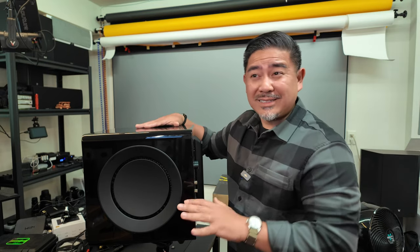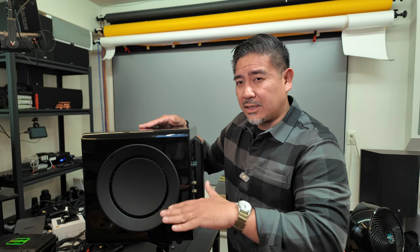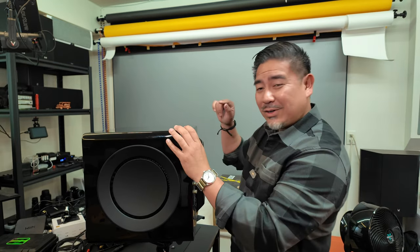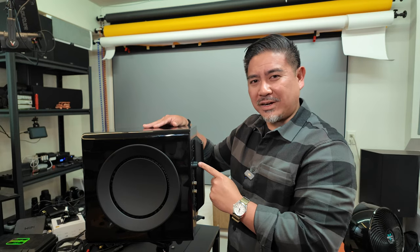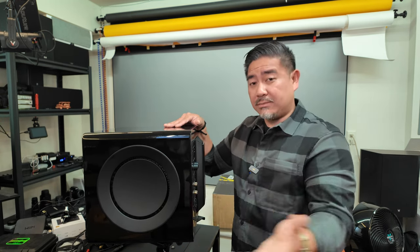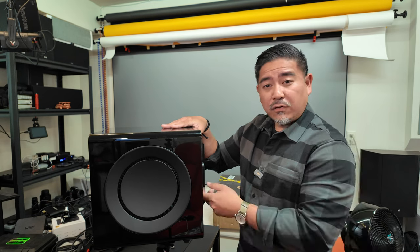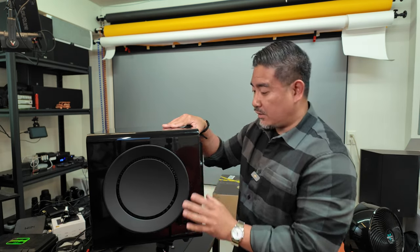Pros and cons: pros — it's small, it does what they say it will. I was playing 12 Hz test tones through this and it was shaking stuff — it can play certain frequencies loud, just not all frequencies at the same time at loud volume. Hoffman's Iron Law still wins regardless of all the DSP processing, but it's a very smart use of DSP. Cons: the fan noise, and the price — $1,999 is pretty up there. I think this is more geared toward an audiophile, but if that's the case, I wish they had included a delay on the RCA outputs for those who don't want to use room correction.